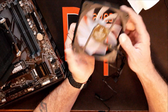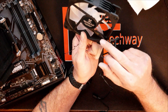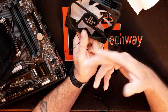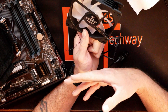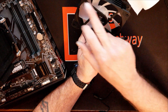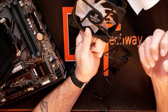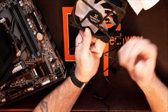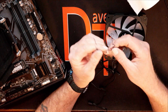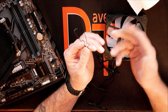Next up is your fan. When putting your fan on, if you're going to put it on the side where your RAM sticks are, you want to make sure the bracket that holds the fan motor is towards the heatsink. If you want to use it as an exhaust fan — pulling air through the heatsink — you want these brackets facing away from the heatsink. I would recommend having the brackets facing towards the heatsink with the fan on the RAM side, so it's an intake fan pulling air in through the fan and then through the heatsink. They give you enough metal brackets to put one on each side if you like, but to me that's overkill.